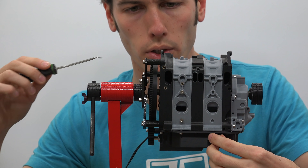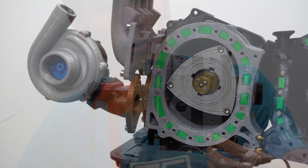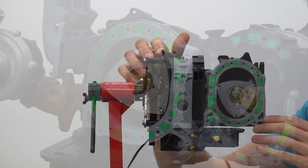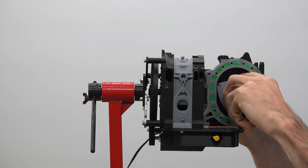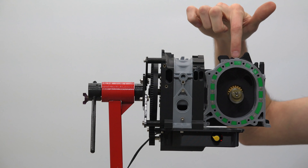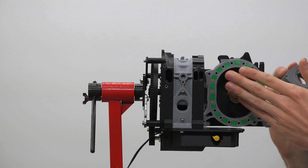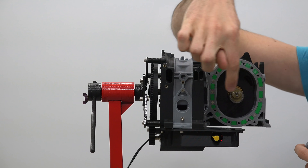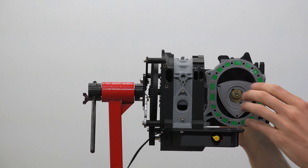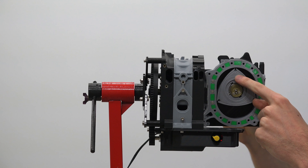There's an electric motor to make this thing rotate, so you can see we can rotate the rotors inside and rotate this flywheel here. Looking inside of the engine, this rotor is ultimately what's powering that flywheel and then sending power from the flywheel to the transmission. This rotor rotates on an eccentric shaft which is in the center here, and this eccentric shaft comes all the way from the front plate to that back plate to that flywheel and it's rotating that flywheel. Here it's just cut off so that you can see inside of this engine, but that rotor is going to rotate on that eccentric shaft and ultimately power is produced by forcing that rotor to rotate.